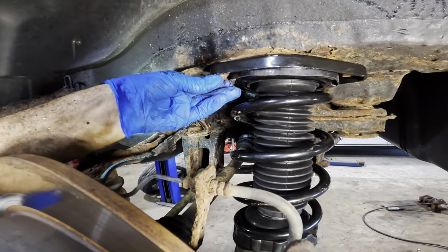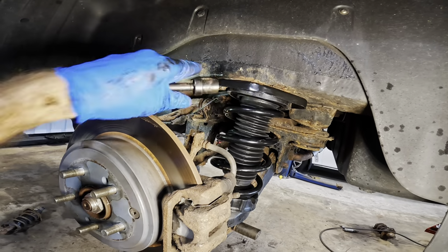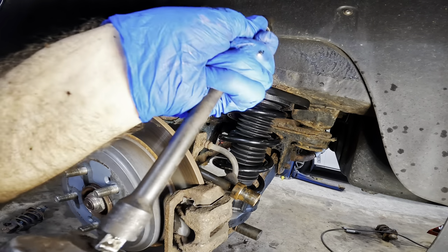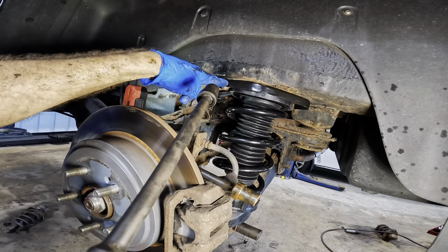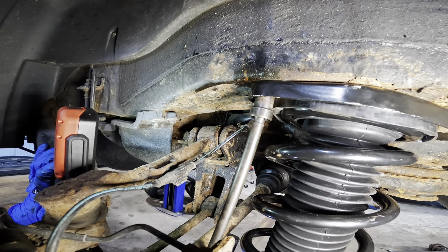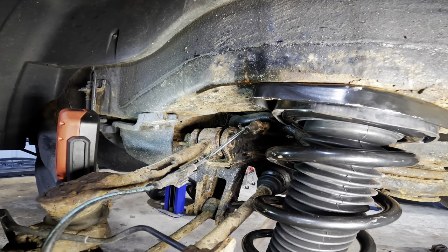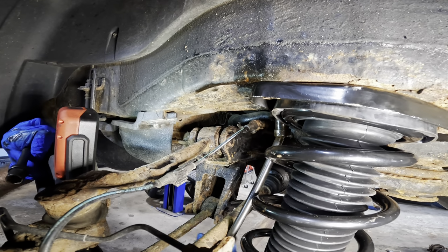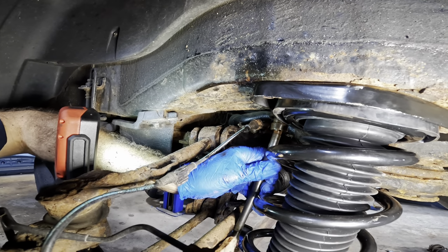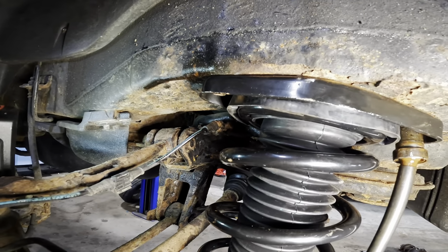Look at that, beautiful. It's threading in. Victory. It's actually a victory of the highest quality. So that's a 15, that new bolt was. The old ones were 14s. Let me pop this guy off, switch it out. And we'll tighten that one up next. Okay, up through the little opening there, onto our fastener. Look at that. She's tight. That was a success. Let's get those other two torqued all the way, because they were not. That one. And then the one off to the right here. Get on there.